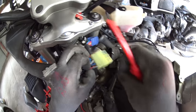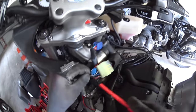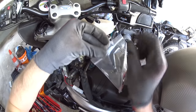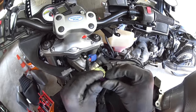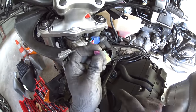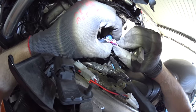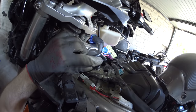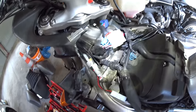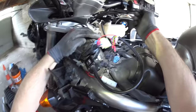The one we're after is this red wire here, which is the feed to the side lights that only come on when you turn on the ignition - see. So when they're on, the device will be on, which is perfect. I'm going to hijack that cable for my positive. For this purpose, the kit includes these little gadgets - the idea is you crimp that over the cable and the back end provides a connector for a spade to go into. Let's do it - clip onto the wire making sure the wire is in the slot, give it a squeeze with some pliers, and it simultaneously cuts the sheath, makes contact with the wire, and locks itself in place. Then the live feed for the device just plugs into the back end of that socket.